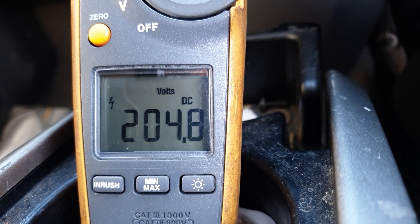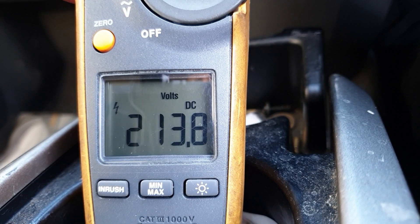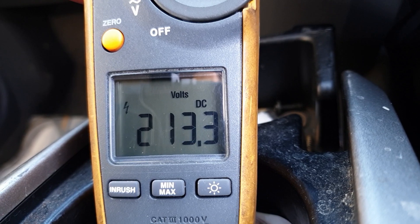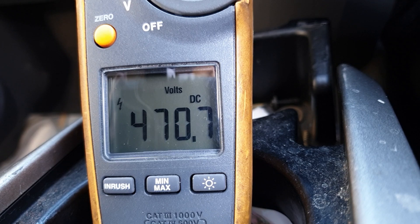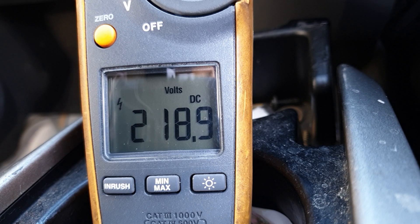Come to a stop, handbrake on, into park — engine start. Okay, engine is now running and we are battery charging. What I'm going to do now is press the accelerator to the floor, which will bring the revs up. At this point with the revs high, we do see the HV voltage increase. Let it off and we pretty much drop back down, and we're just battery charging.